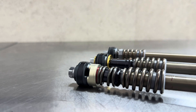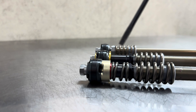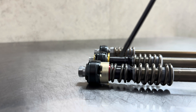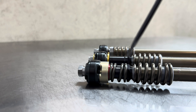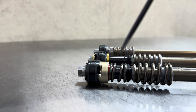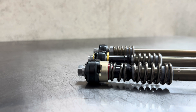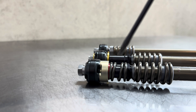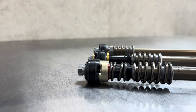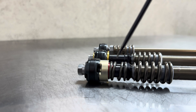In between the cone and the cone spring, there's a very thin washer. Those washers can be utilized if you want to preload the cone spring, have zero preload on it, or even have some free float. The third tuning part is the cone spring itself. This is a 50 newton cone spring — very common for off-road and motocross applications. We also have one softer cone spring at 25 newton, and a few stiffer options above the 50 newton.